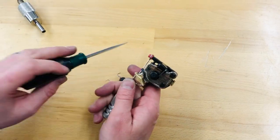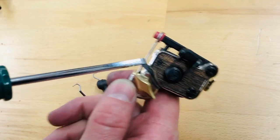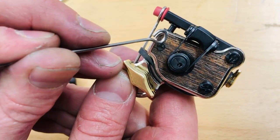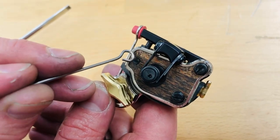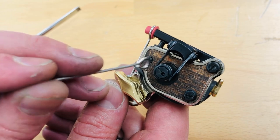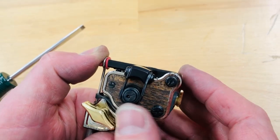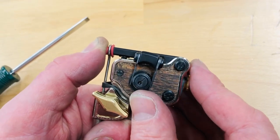Let's talk about the impact adjustment. I made this adjustment so that you shouldn't ever really have to mess with it. You see that little line — there's a cross tip for your screwdriver and then a little line pointing straight up. Most machines are gonna be pointed straight up when you get it, or slightly to the left. On the left-hand side the tension goes up — the impact increases. When you push the bar down and roll this over, naturally this line should point to about a 2 o'clock position. If you increase this, it's gonna raise the point where that bar hits, and it's gonna raise that line.